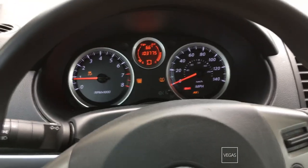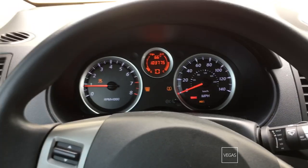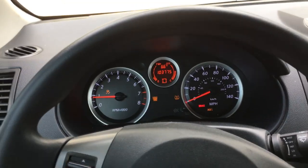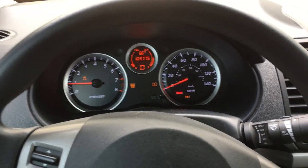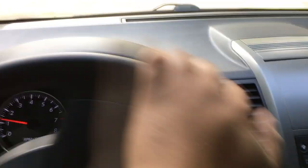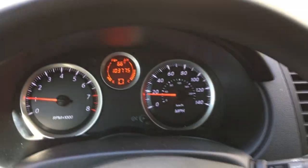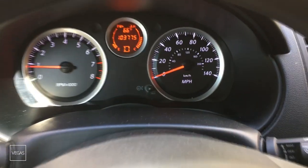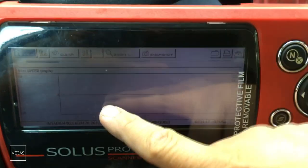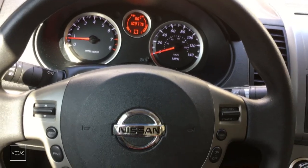One of the things my friend mentioned is that the speedometer will work if you clear the check engine light. After you clear the codes, the speedometer will work at speeds under 60 miles an hour. Once you hit 60 miles an hour and above is when the check engine light comes on, the speedometer quits working, and the codes get set in the computer. So I'm going to go ahead and try to recreate that. I cleared those codes and now I'm going to take it for a drive. The speedometer is working right now after clearing the check engine light. I want to graph the VSS signal on the scan tool and compare it to the speedometer. I've singled out the vehicle speed sensor data PID and I'm graphing it right now.